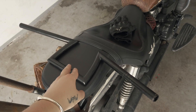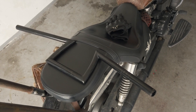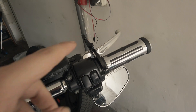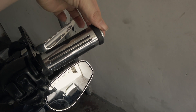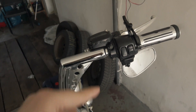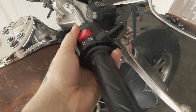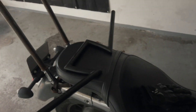What I want to do this episode is replace these bars with these — handlebars from a Triumph Bobber. Since I have this kind of throttle setup I think it will be okay. If I had an electronic throttle like my Harley, where it's basically twisted with a little knob and all the wires are inside the bars, it would be harder. But everything should just be on the outside, so I should just need to remove this, remove that, and slide it on.